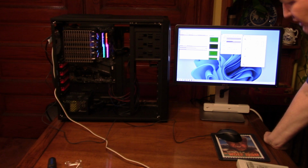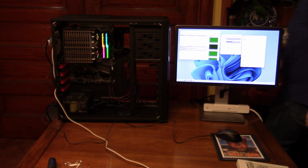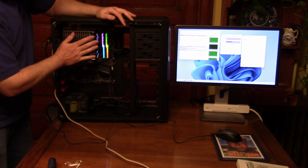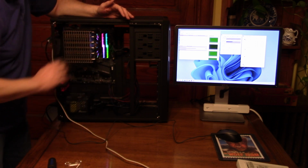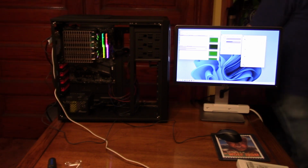It went back up to, we might have reached equilibrium here at 62.4, 62.5 degrees, 62.8 is the max. Maybe it'll get a little hotter, but I think we're going to be fine. We can probably tax this processor full load and it's never going to hit 70 degrees on the silent PC. Yeah, it feels a little warmer, but I think we've kind of reached an equilibrium, which is nice. Yeah, that'll work well. I don't think I want to run it in the summer in the 90-degree heat.